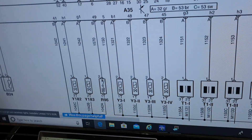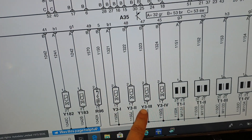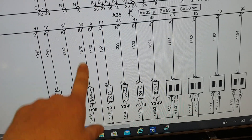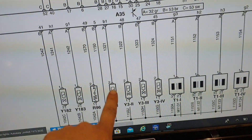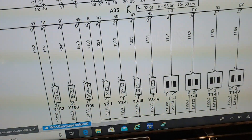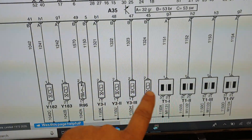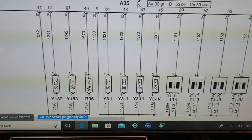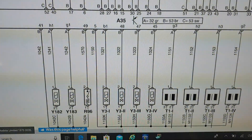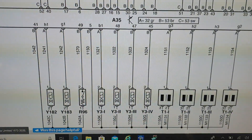What we've done is look at a diagram directly at the ECU. We have access to injectors one, two, three, and four — they're all supplied by pin number five on connector B, and then individually switched. So what we're going to do is energize each injector manually to get a fuel pressure drop, so we can measure the drop in pressure. That will give us an idea if one is flowing too much or not enough.